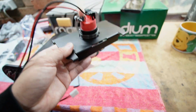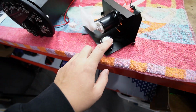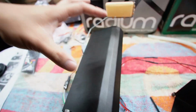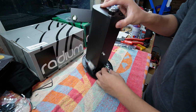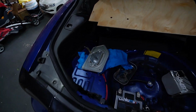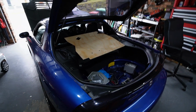Now this baffle sits inside that little yellow tank where we removed the stock baffle, and there's a little check ball valve here. It opens and closes on decel and acceleration. I've also gone ahead and installed the sub tank with a sensor and a new gasket onto the hanger. So I'm anticipating everything should be very straightforward. We'll drop in the lifter tank and then the surge tank. Once we do our wiring, this car should be all systems go, and we can probably take it for a drive today. Fingers crossed.